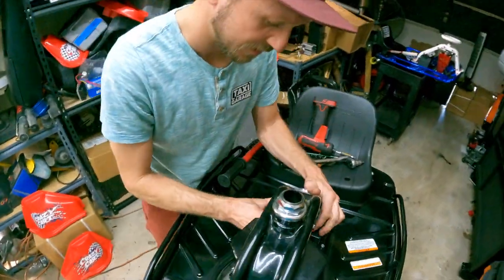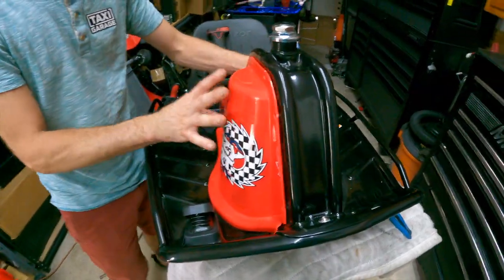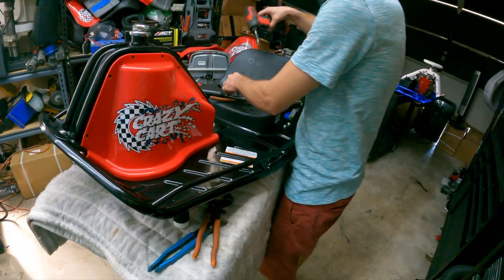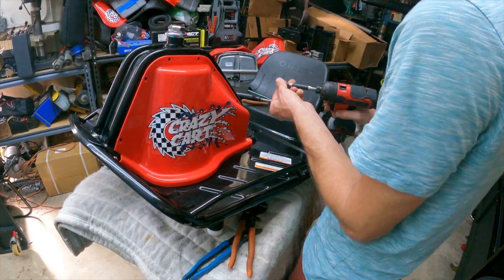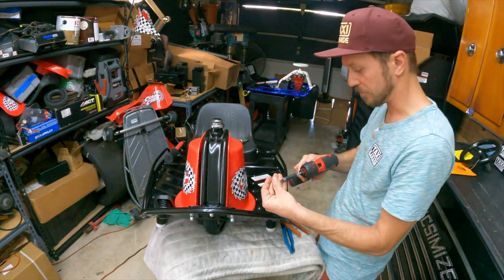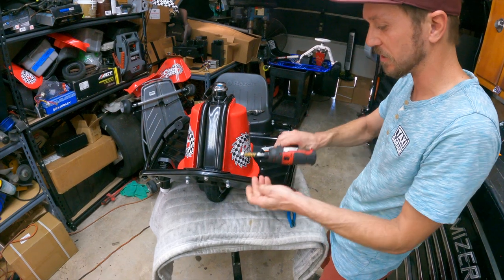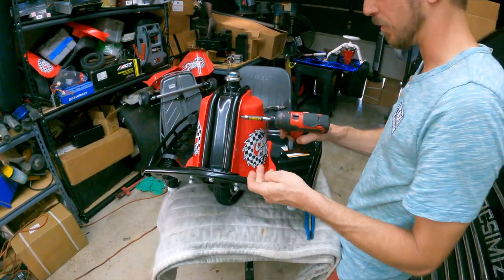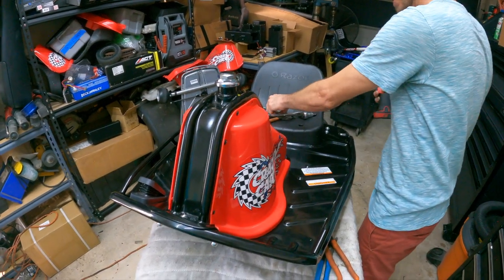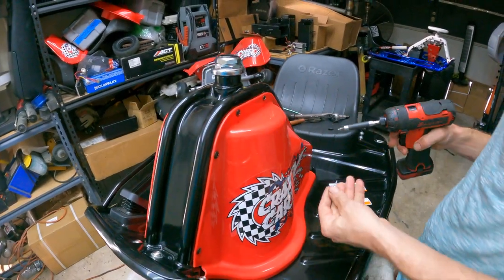Place the throttle cable in position so the covers fit back over with no issues. Sit the plug over the batteries, then slide the covers back and line them up with all the holes. Start your screws — I like to start on the far corners first because starting from one side makes it difficult to line up the remaining holes. Do the two outer holes first, then work left to right. A power screwdriver is definitely recommended as this is somewhat tedious by hand.